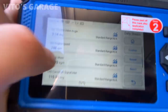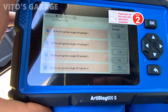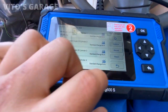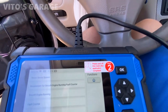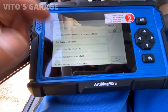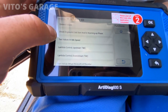Another cool thing — you can check for any knocking in your cylinders. You can see it's all zeros. If you put the wrong type of fuel in — like regular instead of premium — it's definitely going to start knocking, depending on the car and engine. You can really check anything with the live data; that's the most important stuff — O2 sensors and everything.